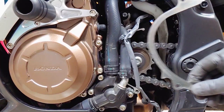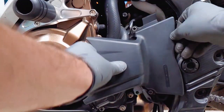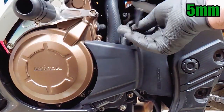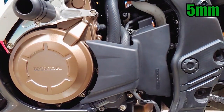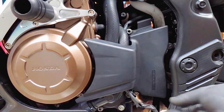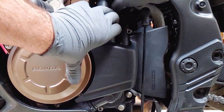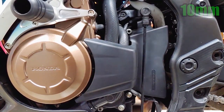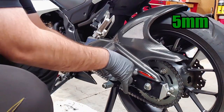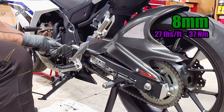If they are, re-torque the drive sprocket bolt to 40 ft-lbs and the driven sprocket nuts to 80 ft-lbs. When installing the front sprocket cover, position the metal chain guide with this point on the bottom. Reconnect the upper band clip and hold the sprocket cover in position while you install the two 5mm screws. Don't forget the lower band clip. Reattach the shifter linkage lining it up with the mark you made earlier, and install the 10mm bolt. If you removed the chain cover, reinstall it with a 5mm hex. The foot peg bolt should be torqued to 27 ft-lbs.